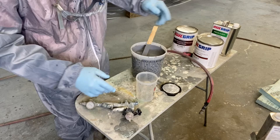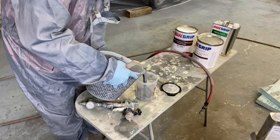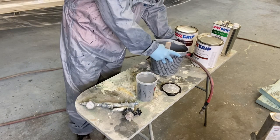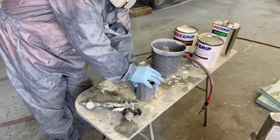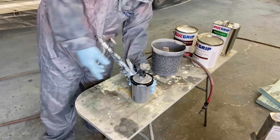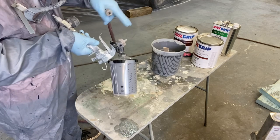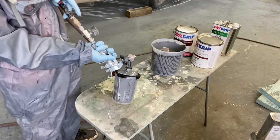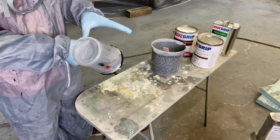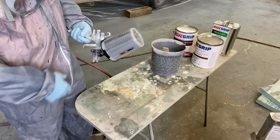For non-skid or other heavy products, pull the screen out. I'm going to fill my cup up with my 545, put my lid on there, lock her in place. For the gun attachment, you just squeeze it on top and turn it until she locks in. When you first start out with the 3M AccuSpray and you've got your paint hooked up, you want to keep your gun upside down and squeeze until the bag sucks and product starts flowing out. Once that happens, you've achieved pressure-fed, gravity-fed, suction-fed — all the above — and you can turn the gun any which way you want and shoot at any angle.